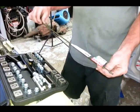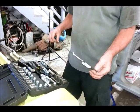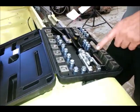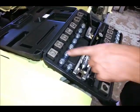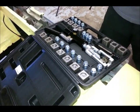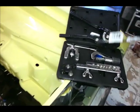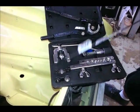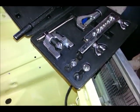You can get this at any local auto parts store — it's just 3/16-inch mild steel brake line. They always come double-flared at 45 degrees, with 3/16 fittings on the end. If you do a lot of them you'd probably prefer a hydraulic flaring tool — a lot faster and a little bit easier. A professional tool like that off the tool truck might run around $450, but you don't really have to spend that much. You can get something in the $50 range at your local parts house — even Harbor Freight. It comes with everything: a tubing bender, a cutter, and flaring dies. This kit handles from 3/16 all the way to 3/8 hard line.